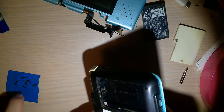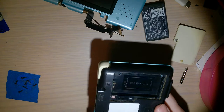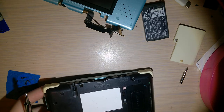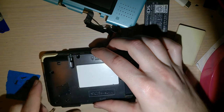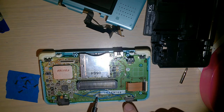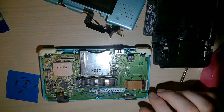You've got to take out all the screws. There are seven tri-wing screws in the bottom: two of those are in the battery compartment, two across the top, two on the other side, and then one in the Game Boy Advance slot. After you get those seven out, the bottom just lifts off. You can see where I accidentally drilled a hole in this motherboard and had to run some bodge wires.